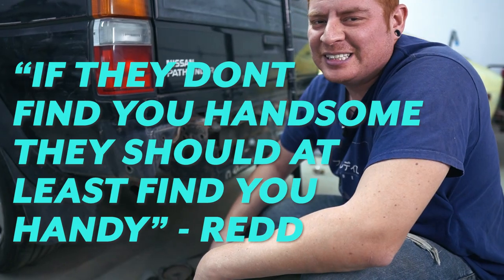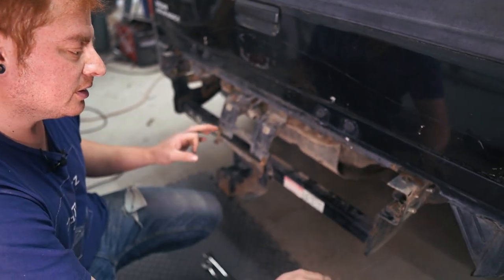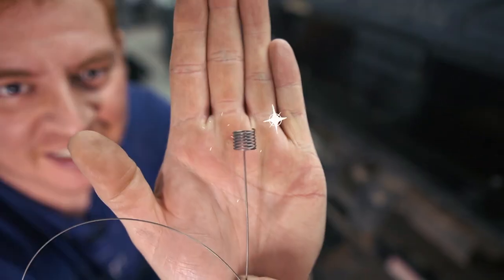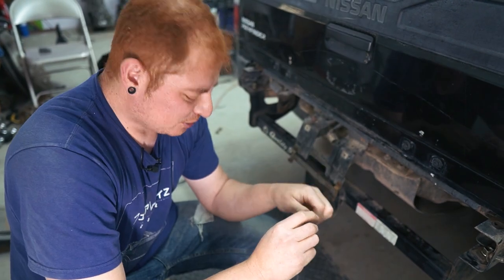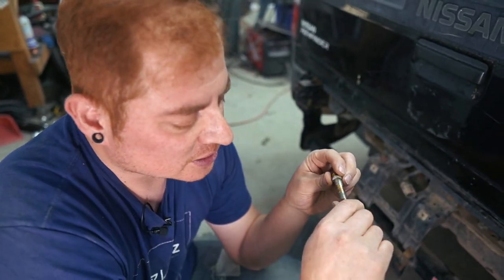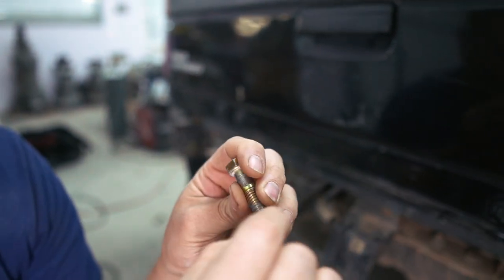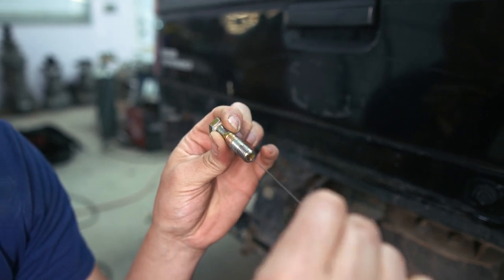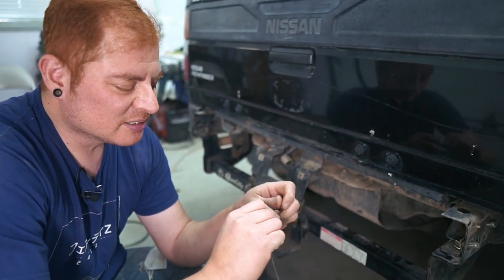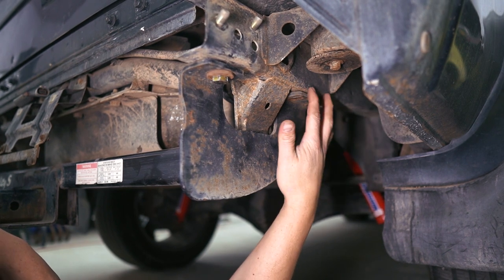Alright, that worked. If they don't find you handsome, they should at least find you handy. So we've got our hitch mocked up and now we need to put all the bolts in through the frame rail. To do that we're gonna use a tool I just found out about — this fishing wire for bolts. You order it in whatever bolt size you're working with; they're super cheap, like two or three bucks. It threads onto your bolt — the thread pitch doesn't even matter because it's a spring — and as long as it's the right diameter it holds your bolt pretty tight and lets you feed it through spaces where you can't get your hands.